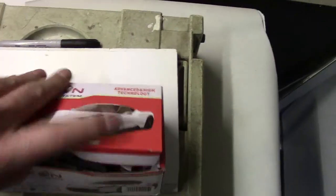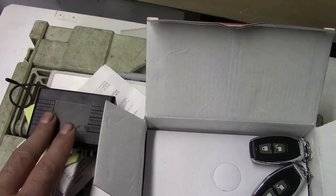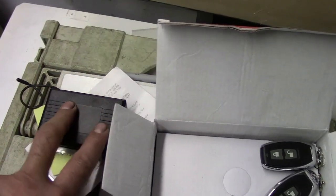What I've done is bought myself a remote central locking kit off Amazon. It's just a remote control relay - I've got a few of these, but I bought a central locking specific one because this one will invert the live and earth. Most remote relay kits just switch the relay on and off; they won't invert the live and neutral, which is what you need for these aftermarket central locking activators. They've only got two wires: live on the yellow, earth on the green, then live on the green, earth on the yellow to lock and unlock. This does that. It's got two remotes - one to carry, one to hang inside the van.